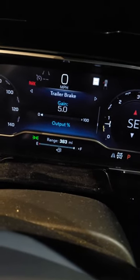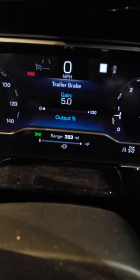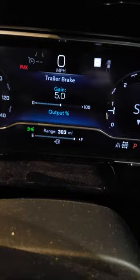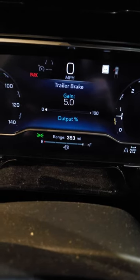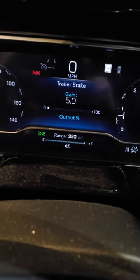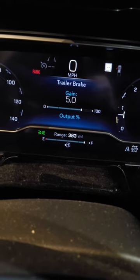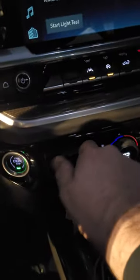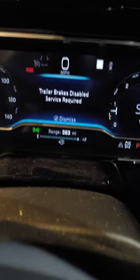If I use just the brake pedal — gain set to five — pumping the brakes works just like the squeeze switch does at first. But if I use the brake pedal back and forth and it tends to error out, the brake pedal will trigger a complete disable. And there it goes — it wigged out. Unlike the squeeze switch which resets momentarily and continues on, it completely disables the trailer brakes when the error is triggered using the brake pedal.